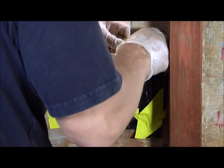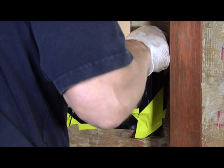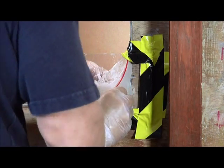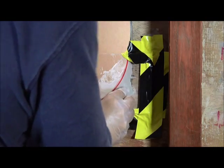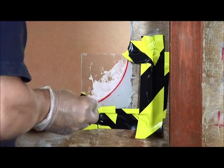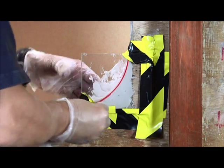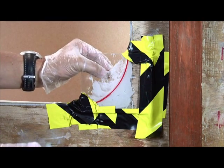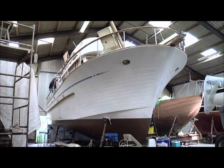I'm just going to tape around here to the outside so that that's nice and tight. Pinch the two perspex sheets together parallel with the cabin walls and tape them in position. We can grind that back tomorrow — that's a quick and easy way to fill in a corner, and we have a finished job. Now walk away for a full 24 hours and allow the epoxy to work its magic.